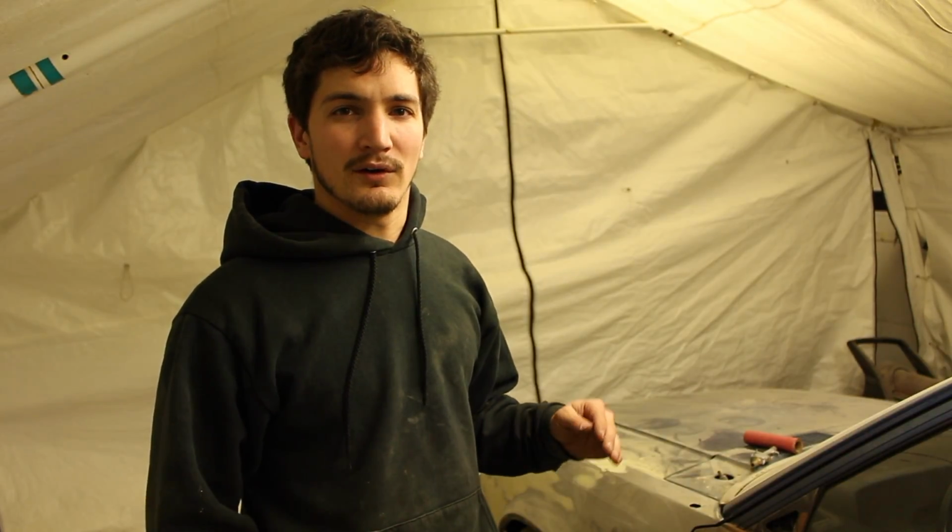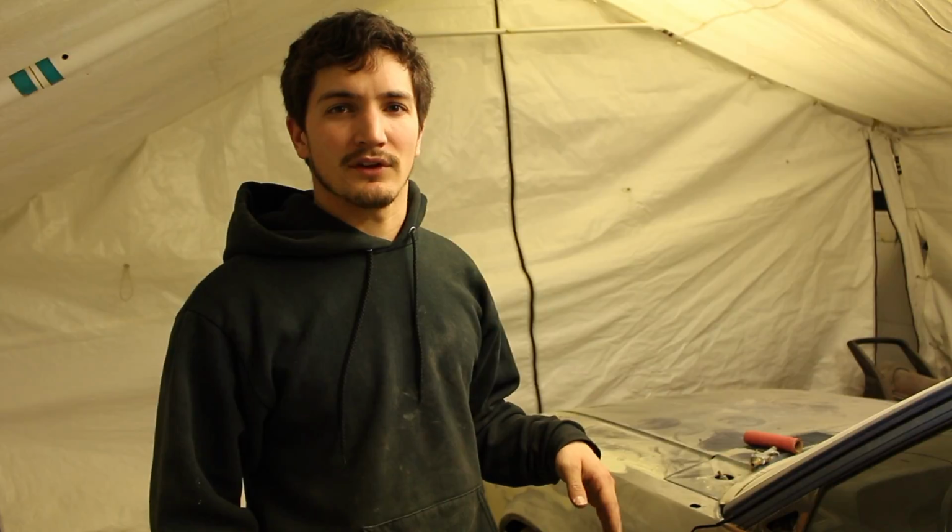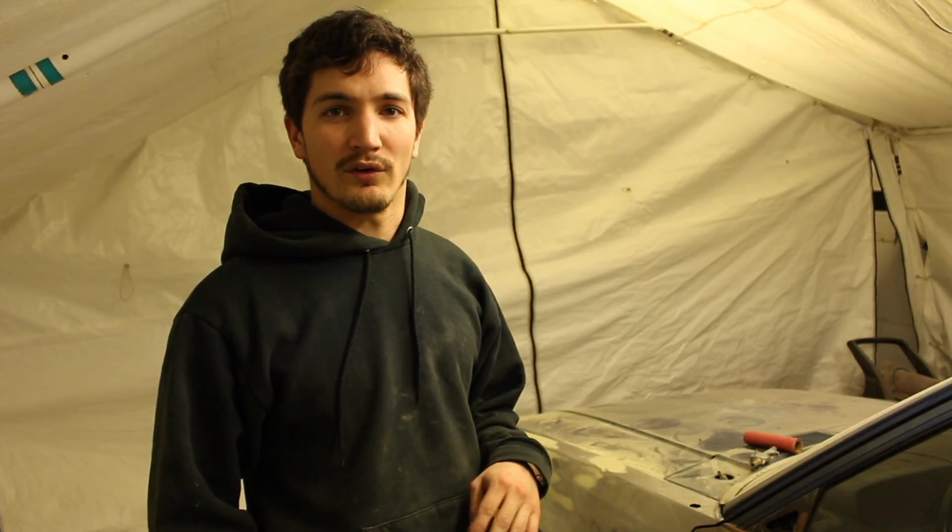First thing we're going to do is sand the bodywork that I've already got on here and the fender to 220. That way we can have finishing scratches in it, so the primer will grab to that and won't have those deep scratches that you see show up in paint later on. I do have to cut this a little quicker than I would have normally, because I have to use the garage space to do other people's cars.